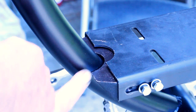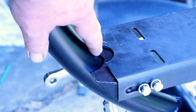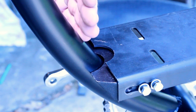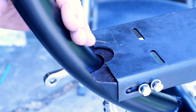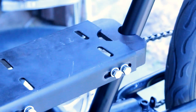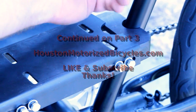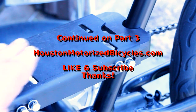I'm doing a test fit of the kit-supplied motor mount and we have a problem — there's a gap where the mounting plate mounts to the frame. You either want to shim that up, because leaving it means one edge of your mounting plate is striking the metal and you won't have a good flat fit. All the stress will be at one point, which could eventually lead to cracking or failure. You want your mounting plate to be firmly against your frame from bottom to top. I have the same gap issue in the back — the mounting plate is at an angle, not sitting flat against the frame. So what I'm going to do on this bike is go ahead and weld in a custom mounting plate for the motor.